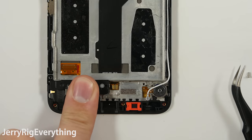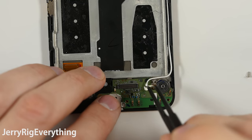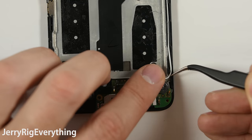There's one screw holding the loudspeaker in place. Set that down, charging port goes in — one screw at the top of that as well. Same little signal wire cable — pinch that down and tuck it into the plastic frame.